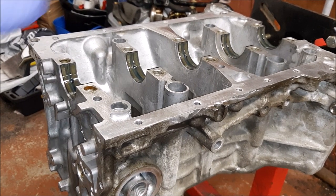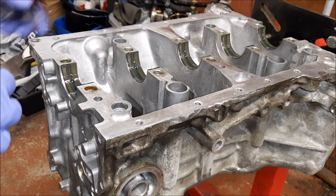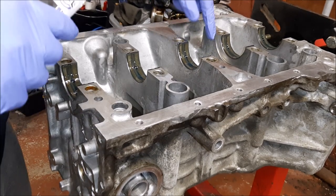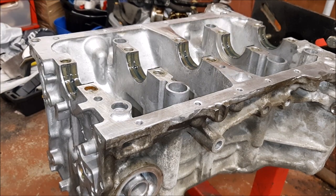As a noob, I was going to drop the crank in dry with Plastigage, because that's what we're rolling with — we're not a specialist operation here. We need to basically lube the bottom half, maybe spin the crank or do the top half as well, then clean it up and check the clearances. I'm going to get the fresh washers and fresh bearings, put one this side, one that side, and then we can put the crank in.